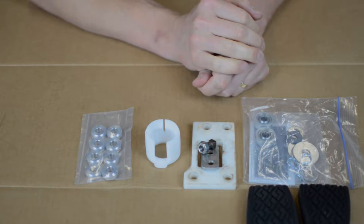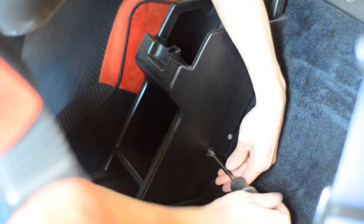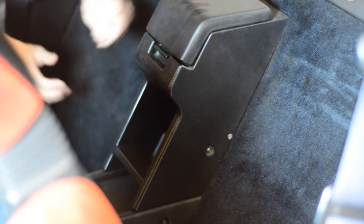We're going to take some pieces out of the interior - center console, shift knob, all that stuff. First off, we're going to remove the center console. To do that, it's just a bunch of Phillips head screws, but you do have to take this little storage box off the back if you have it. You've got two back here up against the firewall and then two that go into brackets on the side behind the seats.